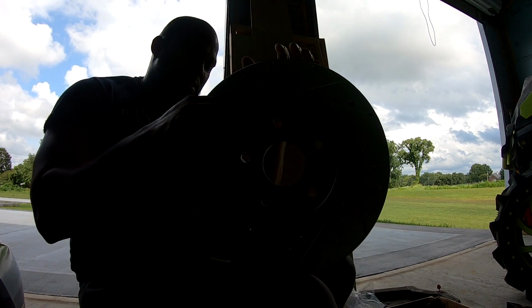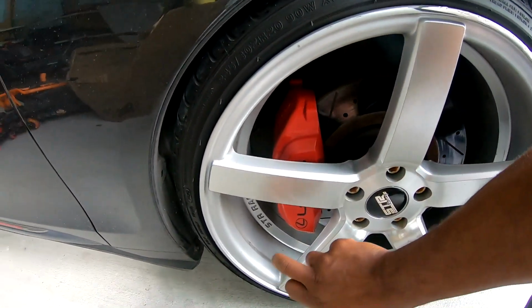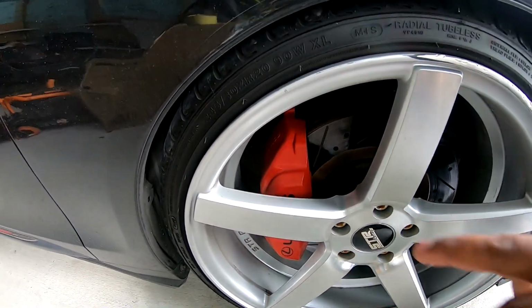You see about a third more of the surface area. It's a lot wider, a lot more grip for that bigger front brake pad. And that's the thing about these. See, when you got the 430s, the 450s, and 460s, they got the big brake on the front. See, all the Lexuses don't come with the big brake. Only certain models, the bigger, higher power models come with the big brake on the front, the 4-piston cylinders. And they got the bigger rotor.